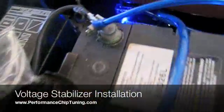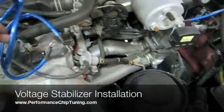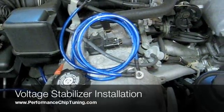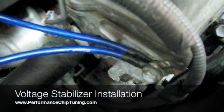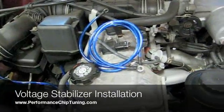Once we got our Voltage Stabilizer installed and also mounted in the correct location, our next step was to ground the body to the actual motor itself. The grounding kit comes with basically about 5 grounding wires. We used about 4 of them today. I have 3 more here depending on what type of vehicle you have, you might be able to use all of them. I am going to show you some of the places that we actually did the grounding. As you can see, there is a good grounding point on the motor itself. It splits off into 2 locations. And we also did a ground on this side of the motor itself. It goes directly to the body.